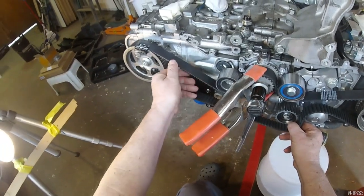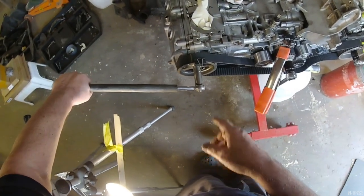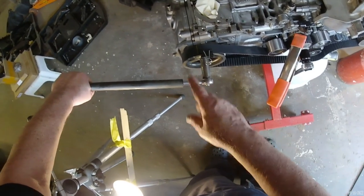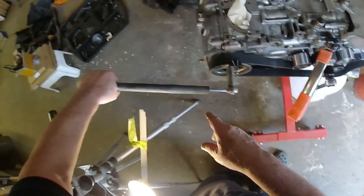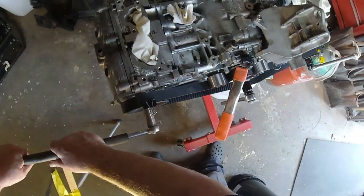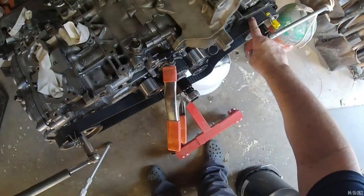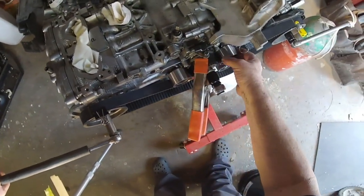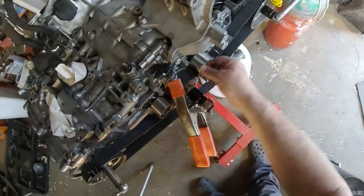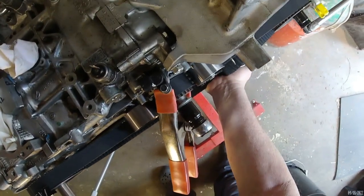Well, maybe I need to pull the opposite direction on this one. Hold on. Okay, I've got another genuine sprocket torquer thingamajig doohickey here. Tighten the belt with. So I'm tightening it between this pulley and this pulley, taking all the slack out of here. The belt tensioner is jammed up against the case. And oh, I got it. It's going on.